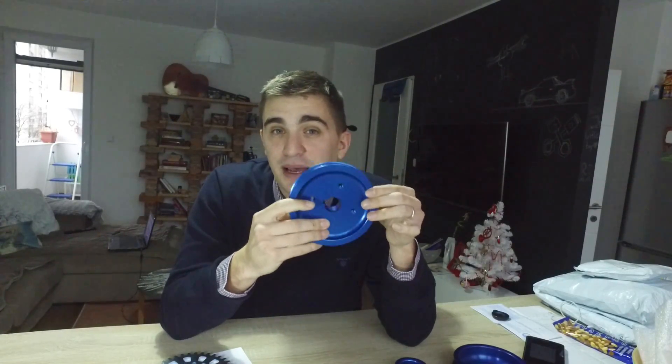You cannot buy a crankshaft pulley new from the dealer, so your best bet is replacing it with a high-quality lightweight pulley. This will actually restore internal balance to your engine because the rubber in the original is definitely gone — which is why many people who install high-quality lightweight crankshaft pulleys claim their engine runs smoother afterward. People who claim these lightweight pulleys caused catastrophic damage often installed them on abused, poorly maintained engines that would have failed for many other reasons — like a malfunctioning air flow meter causing a lean condition — long before any crankshaft pulley could.